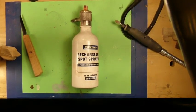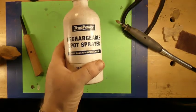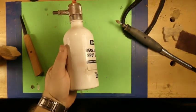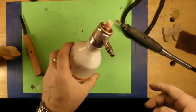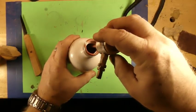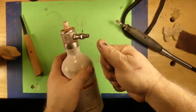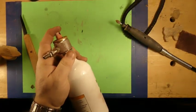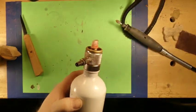Hey guys, welcome back — Just Car Rob. All right, there was some interest in my rechargeable spot sprayer. All you do is put a mixture of your favorite paint and thinner in here. I mix it up outside, make sure I get the right thickness, unscrew the top, fill it up, screw the top back on, put air in via the Schrader valve, get it charged up, and squirt squirt squirt — just like a regular paint can, except you can mix your own colors and put it in here.